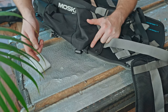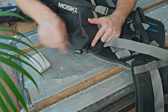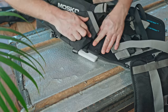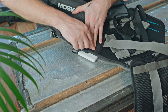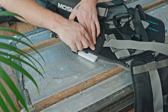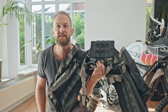There are two tips I can give you here. First, do not try to apply pressure before you have put something in between the foam and the nut — you will not be able to apply enough pressure to get it in. Second, when you have the first one in, do not tighten it fully. First install the other two, and once all three are installed, then tighten them up. And that's it — you've successfully mounted your Rectus 40 system.